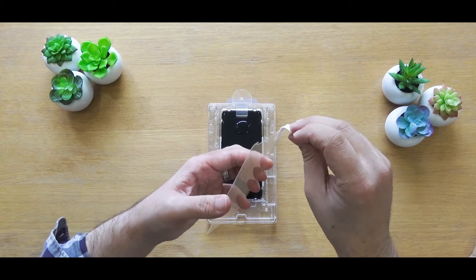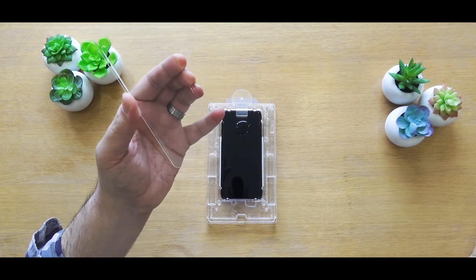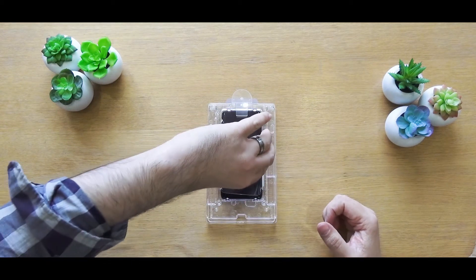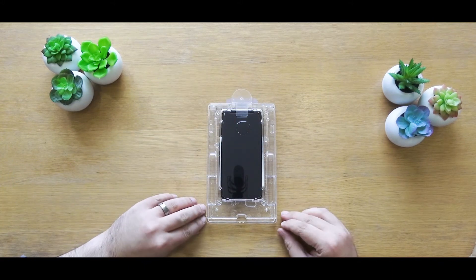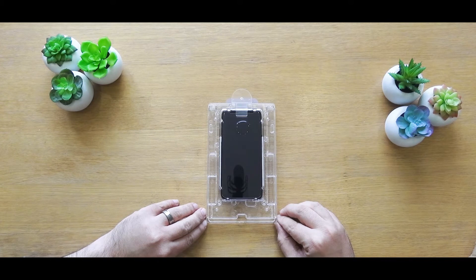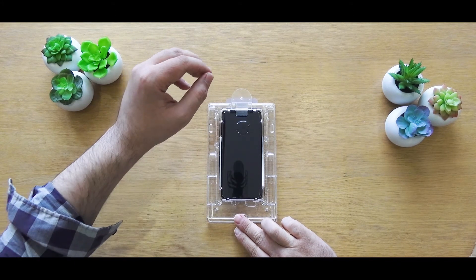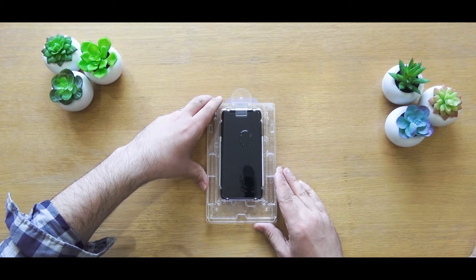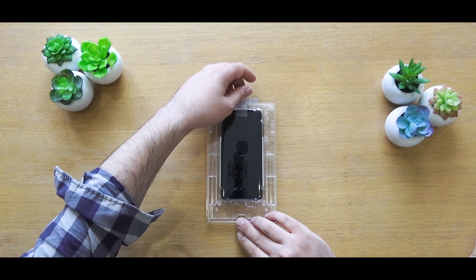You'll now need to take the glass itself and remove the plastic protective film from the back of it. Hold the glass carefully, ensuring you don't get any fingerprints on the underside of the glass, as this is very important for the next part of the installation. Next, set down the screen protector on top of the display, including the guiding pin that we inserted earlier. Once you've done this, gently rock the tray to ensure that all of the glue moves from the top of the foam down to the middle of the screen protector. Once the blob of glue hits the middle of the screen protector, remove the guiding pin and this will then spread the adhesive evenly across the entirety of the screen protector until it's fully covered.